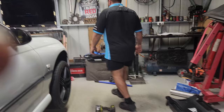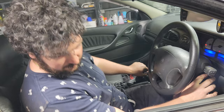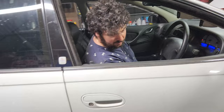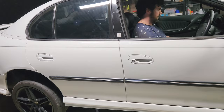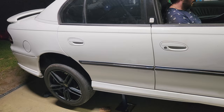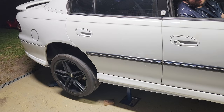All right, so we're just gonna double check now by turning the car over and testing. So what should happen is, if I put this in first gear with no handbrake and clutch in, the wheel should not move, because there will be no actual connection between the engine and the gearbox. Nothing touching? Nothing spinning. Clutch out. Spin. Clutch in. Stop.